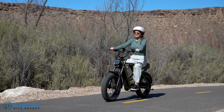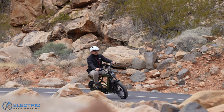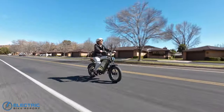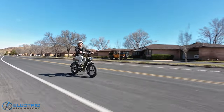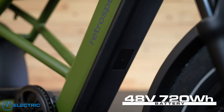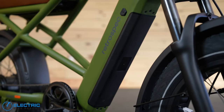RetroSpec fitted this bike to fit riders from five foot flat all the way up to 6'4". That sounds like a really generous range, but from what we found in testing, it appears to mostly be true. Once you consider the fact that this style of bike was never meant to give a proper pedal extension like a road bike would, then that size is fine. The 750 watt motor feeds off the 720 watt hour battery, and the electrical system on this bike is UL 2849 certified, which we're always happy to see.